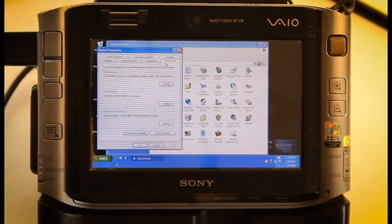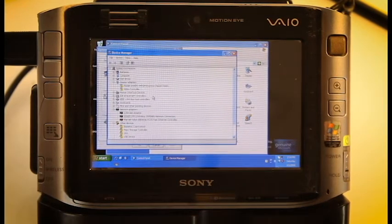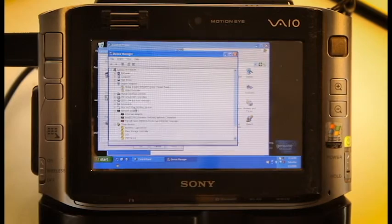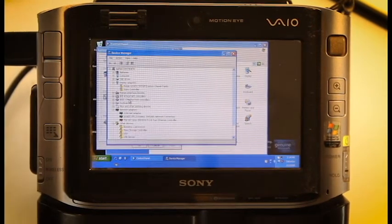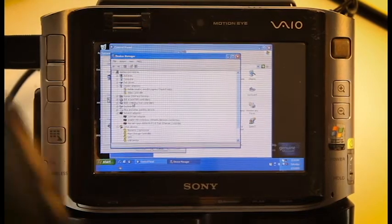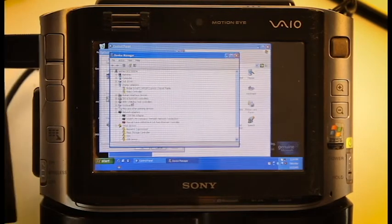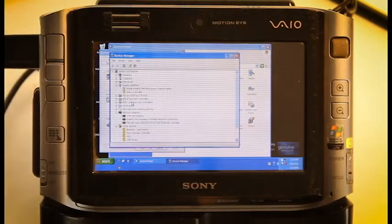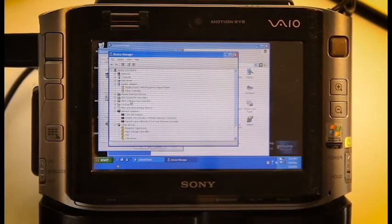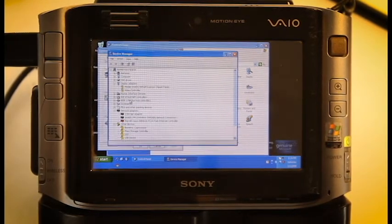Windows XP Professional version 2002. It has an Intel CPU U1400 working at 1.2 GHz and 500 MB of RAM. That's quite nice for this kind of small device. Let's go to Device Manager. Oh, it has problems with driver conflicts. At this point we won't install existing drivers for this Windows version, because later I will try to tear it apart and figure out what hard drive it has. If it has a 2.5 inch hard drive, I will put in an SSD and try to install Windows 10, then install all required drivers.